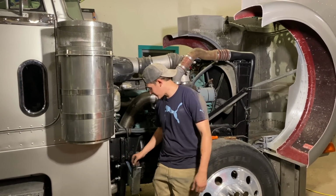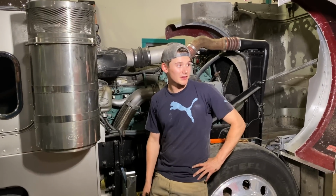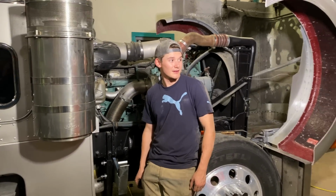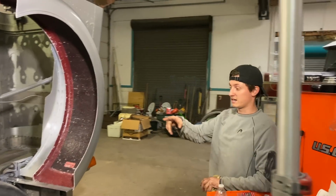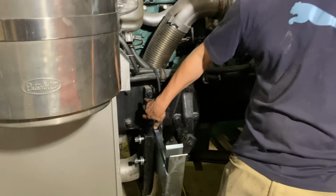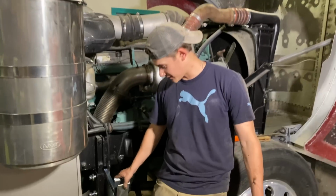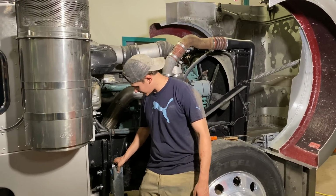The back nut spun off easily, but the bolts were so corroded being on there since 1994, I don't even know how we got them off. We put some WD-40 on there, we heated them up a little bit, and then just started banging out the backside. We thought for a second that post that comes down off the frame would be threaded, but it's not. It's just the amount of corrosion that's been in there for those bolts for the last 20 years that's built up. Gave us a little bit of a headache, but Dave got under there with a sledgehammer and just started pounding them out. And they eventually did come out, but now they're just loose right now because they can go in and out.